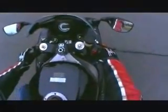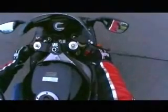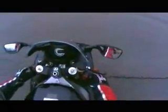To bring the front wheel up, it's going to involve a slip of the clutch and a slight acceleration at the same time. Instead of holding a steady neutral throttle position, you just want to accelerate like that as you slip the clutch. And the first few times the front wheel is just going to crest. It's going to come up 3 or 4 inches.